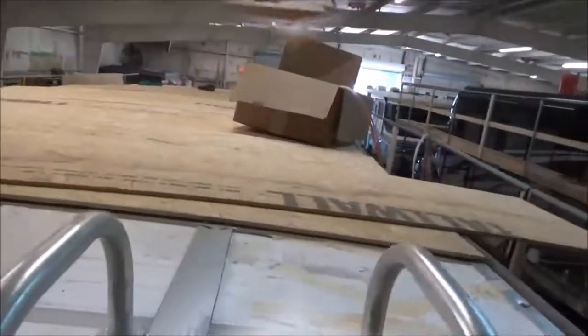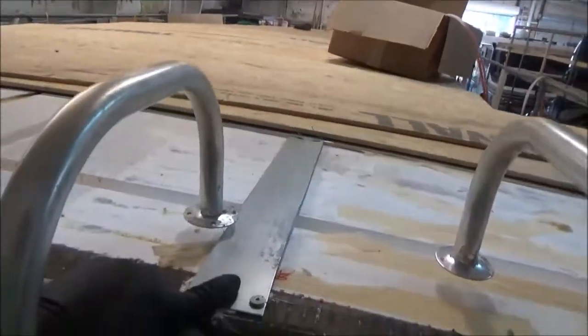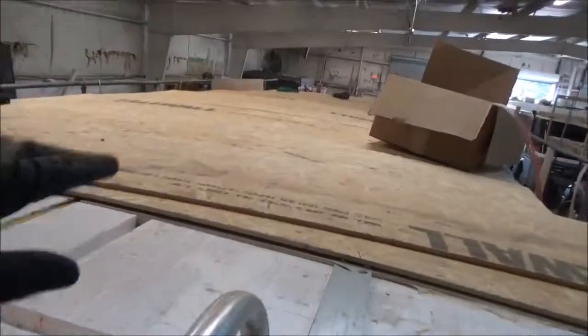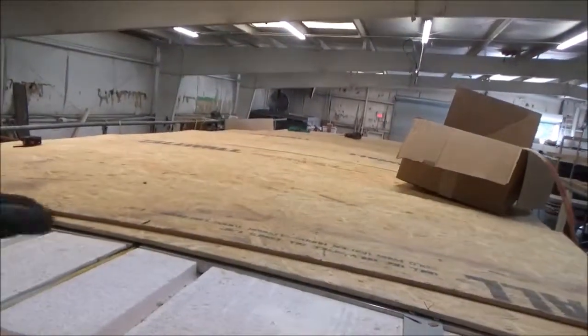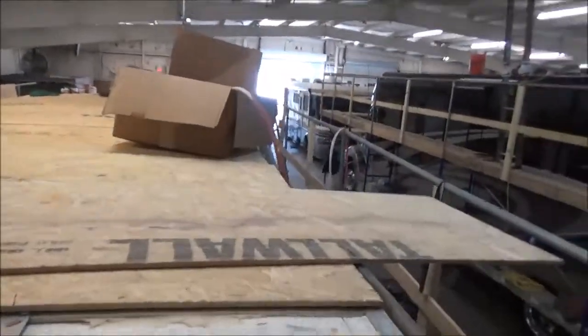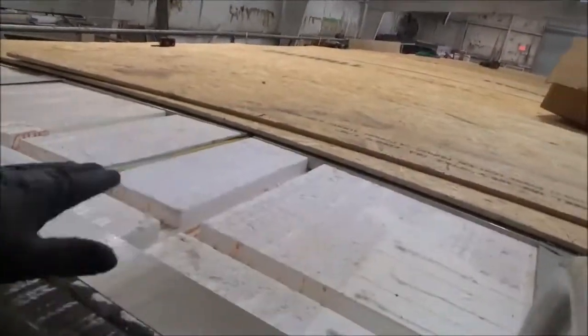Okay, so far on this Condor, give you an update. We've got straps running all the way down, these steel straps, pulling the whole roof assembly together. They're all glued together. We've staged our decking, and now we're going to laminate it right back together. This is the same foam as here, right there in those hoses. So we're going to literally re-foam this all back together so it bonds right in there.